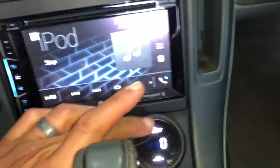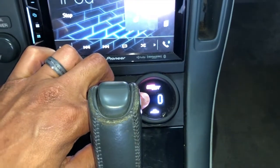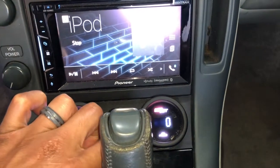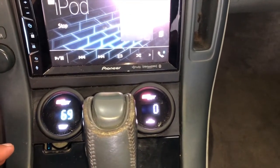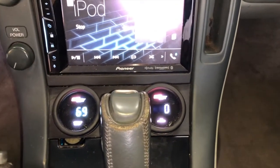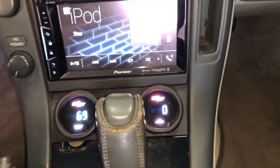The temp gauge and oil pressure gauge are both working. The thing with the oil pressure gauge is you have to make sure you put it on the same ground as the sensor. If you don't, you'll get a voltage differential. Right now I have this issue where the gauge is reading about 20 PSI lower than actual, because the ECU sensor reads correct PSI since it's wired to the same ground, but my gauge is on a different ground and reads 20 PSI less. Scared me for a minute.